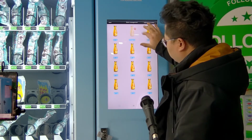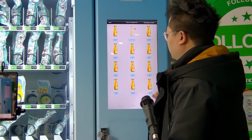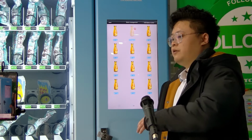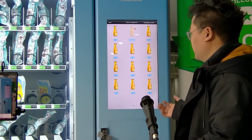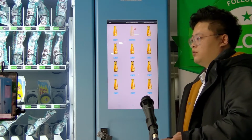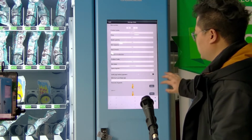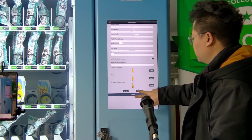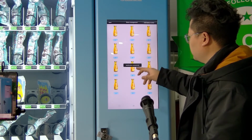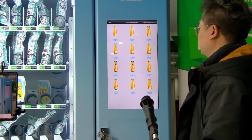Right now we have slot 15 showing 434. It means the product is no longer available. It could be because the product failed to dispense, or the product is sold out. So the machine forbids this slot to run anymore. Under this situation, we need to clear the fault manually. You click the modify button here successfully, and this slot is back to work again.